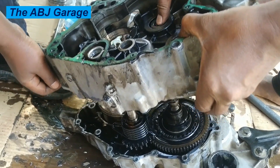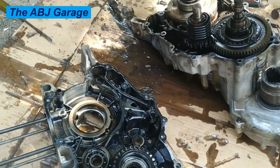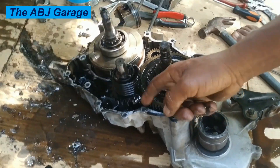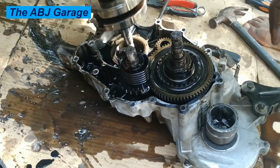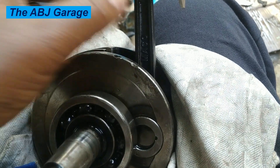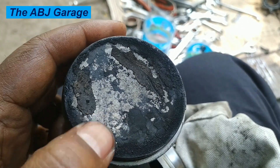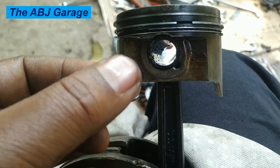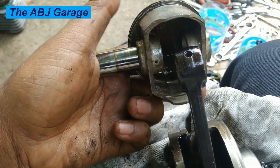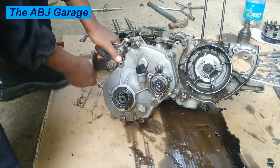With the housing open you can see the differential, the engine crankshaft, and the manual crank mechanism available on these three-wheelers. If you have a problem with the electrical starting system you can use the spring-loaded manual start. The crankshaft and connecting rod assembly can be pulled out, and as you can see the connecting rod is not rotating whatsoever on the crankshaft — confirming total damage to the connecting rod. We will send this to the machine shop where they will press out the old rod and insert a new connecting rod and new bushings. To remove the piston, remove the snap ring on one side of the piston pin, slide out the pin, and separate the connecting rod from the piston. Always be aware of the correct side and direction of the piston when reinstalling.